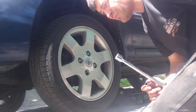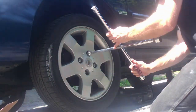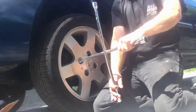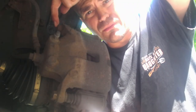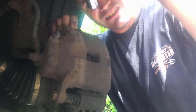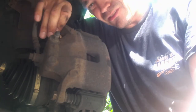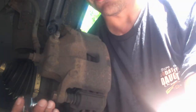As a tip, I always take my lug nuts and put them into a box. First thing I'm going to do is loosen the bracket slide bolts — one here and one here — and then we'll go from there. This is the 9/16-inch socket. We're going to go ahead and put it on here, take this bolt out, and do the same thing with the one down here.